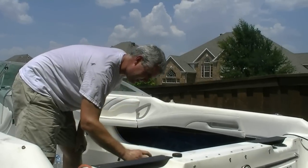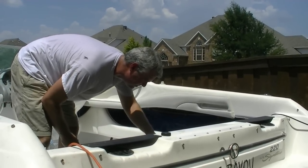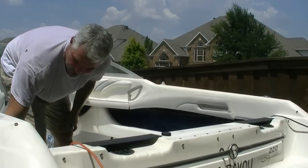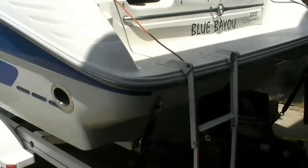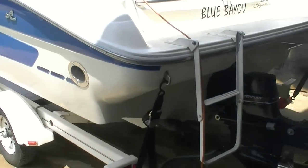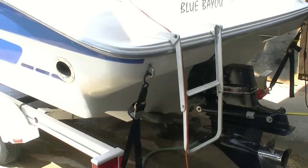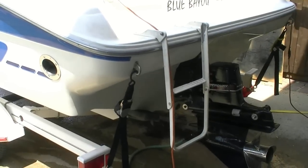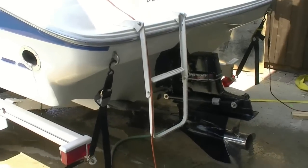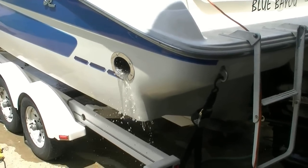We're going to prime the engine just so we can get some vacuum started. See if we can pull the fuel from the tank because it's cranking, and just make sure we're getting some fire. Want to see is that water coming out that way on both sides.